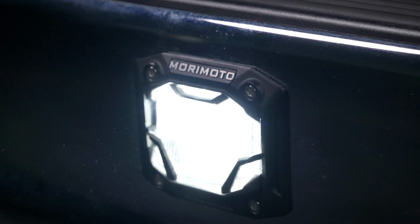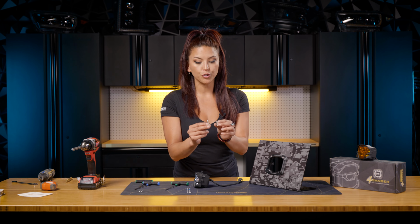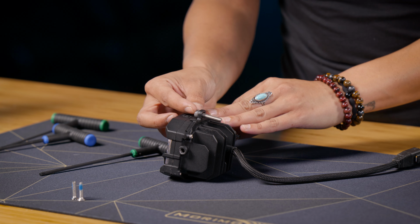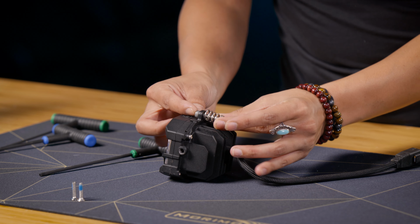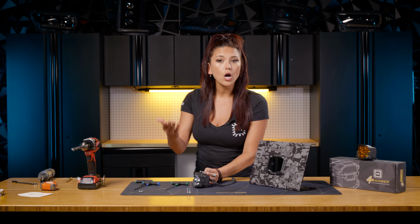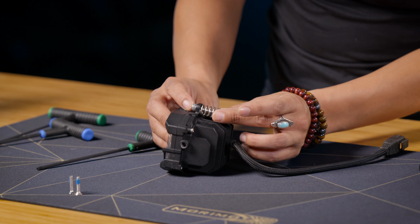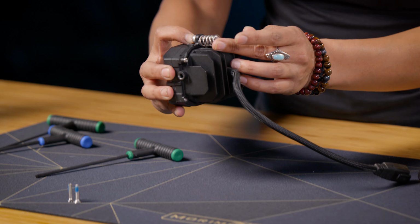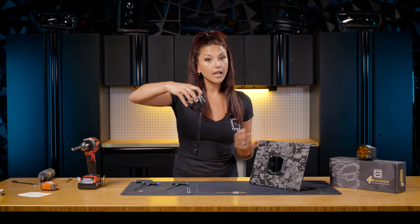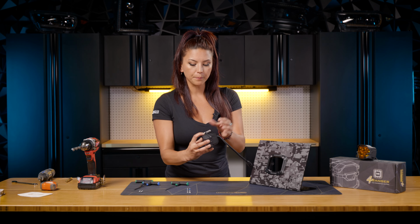All right, now with your adjustment bracket installed onto your 4Banger, we're going to go ahead and move to your adjustment screw and spring. All you have to do is take the screw and line it up into that hole area, and then take the spring and put it on the back side. Another trick with this, you could use a silicone, RTV, whatever type to keep the spring up against this, because at times, sometimes when installing it, depending if it's fully vertical, like upside down, as you see, the spring will come off. So just go ahead and take that and place it.